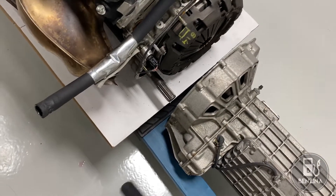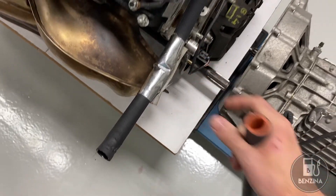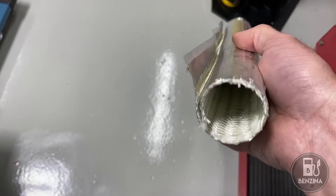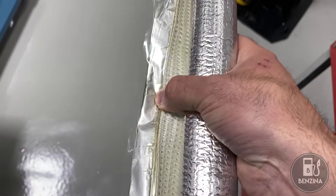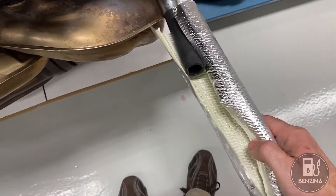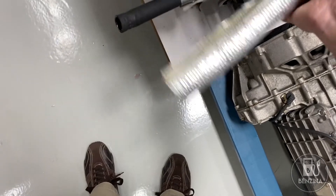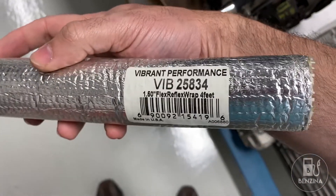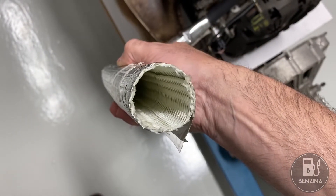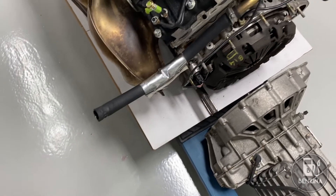The next step is getting better heat shielding in this particular spot. Whereas Lamborghini used this tiny little piece, I'm going to be using a much larger piece of heat shielding material. It's a thicker material as well — it has a cloth braid on the inside. Once you wrap it over the hose, there's a self-adhesive; you stick it and it'll seal the hose. I will be cutting this to size. I got it from Vibrant Performance, also available online. It is a much more substantial heat wrap material than what came from Lamborghini.